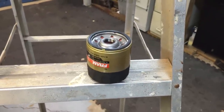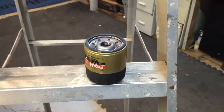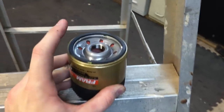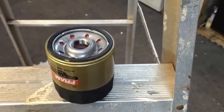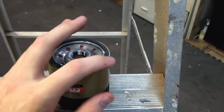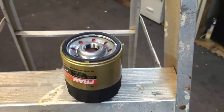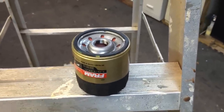Alright, oil is out of the car. Next step is to move on to the oil filter. These cars use a standard screw-on oil filter like any other car. When you're preparing your oil filter, what you're going to want to do is fill up this oil filter so it's primed a little bit with the oil you're filling the car with. Also, a tip is to put motor oil around the lip of the seal right here — in the future when you're ready to change your oil again, it's going to make the whole process a lot easier and the oil filter screw off much easier.